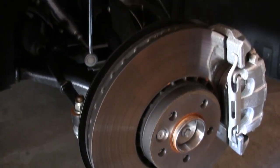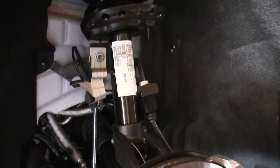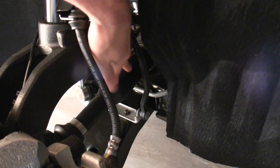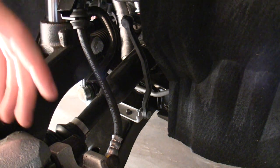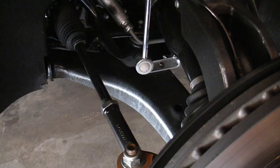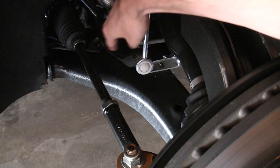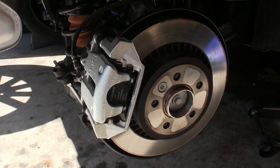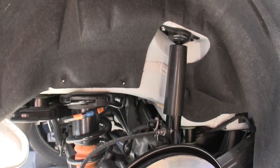Large, a little bit over 12 and a half inch front disc brakes, ventilated, and this is matched with the McPherson strut style suspension. Fairly short half shaft — basically a result of this being an i6 engine, so the engine is very close to where the drive shaft comes out to the front two wheels. Pretty simple and clean looking — you've got your steering link, your anti-roll bar, and then your lower control arm. 11.5 inch ventilated disc brakes in the rear with a multi-link suspension setup with separate shock and spring.